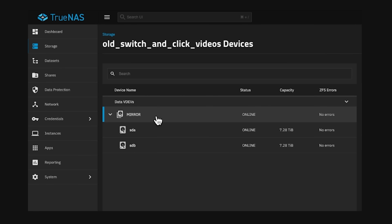Unfortunately I only have two identical eight-terabyte drives, so I'm doing mirrors — which isn't so bad because I have two copies. This is only level zero of my server. In the future I want parity, remote access, and a lot more, but I can't upgrade something that doesn't even exist yet. I've got my pool and my vdev with eight-terabyte drives. If one of your vdevs goes down, the entire pool is done for — this is why redundancies are so important.